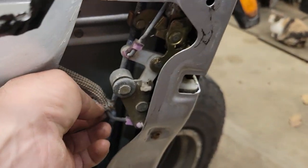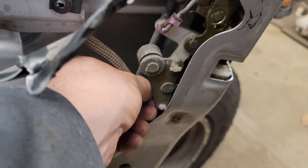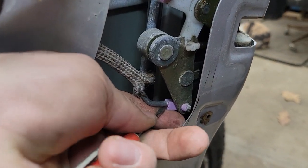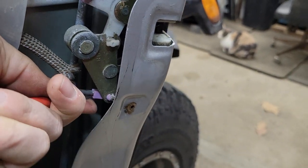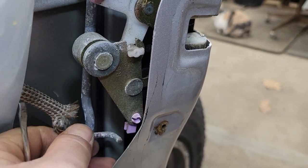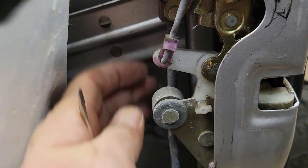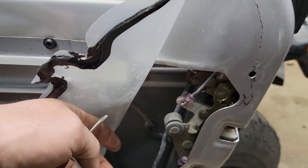So there's a couple of things that I did. This is the rod that comes over from the lock button on the latch — you can go ahead and pop that loose. To do that, you kind of hinge this purple part down. This piece just kind of rotates down — spin it down and that unlocks it and then you can just push this out. Doing that allows you to move the latch around and push it to the outside of the door, which gives you better access through the hole to work. It sure seemed helpful to do it that way.